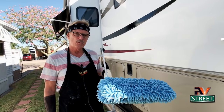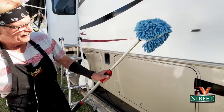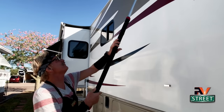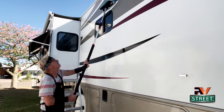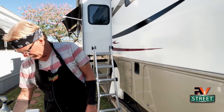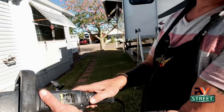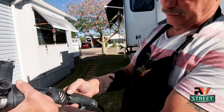I'm going to take my wash wax all mop head. Most of you know there's a wet side and there's a dry side — they're labeled right there, wet and dry. You take the wet side, put a few little squirts on there, and begin to clean. This is one of those tools I just love — it makes those little quick washes so easy to do. So the equipment I'm going to be using is my MT300 Meguiar's dual action variable speed polisher. It has a variable speed dial right here — you can go high or low — and when you pull the trigger, you can lock it in place so you don't have to hold on to the trigger.